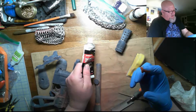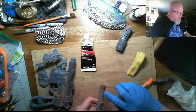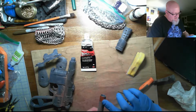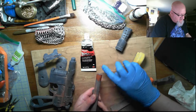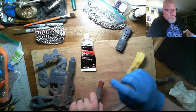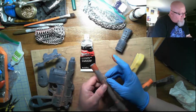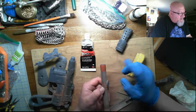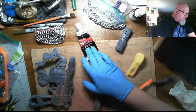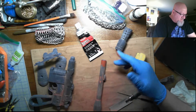And you can get this, like I said, at any automotive shop. They usually carry this. It's usually used for body work, for doing the small little cracks on your car. And I'm talking small cracks in the paint, in the finish. Or where they've actually, it's also used for when they apply big pieces of Bondo. And sometimes you'll get bubbles in the Bondo, and this can fill up where it creates those concaves in the paint job. Here I use it on props just to help smooth it out. And it helps you from buying a big old deal of Bondo and mixing and putting it together. It's all pre-mixed, and it's great for pinhole scratches and minor dings and hairline cracks. And that's basically what we're using it for on plastic. It works great.